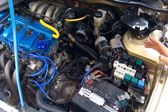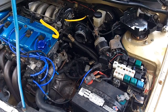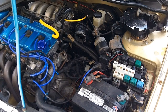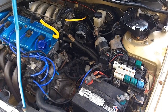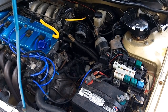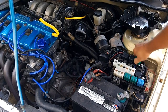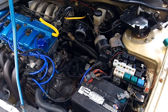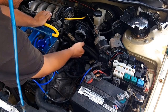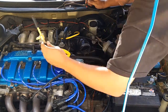On the 93 to 97s — I believe at least 93 to 95, not sure about 96 or 97 — but if the fuel pump relay is green, it's right here. Pull your fuel pump relay, the car will stall. Set that aside, turn the ignition off. Now your fuel pressure line should be depressurized. It definitely smells like fuel over here, so just be careful — don't smoke.